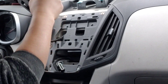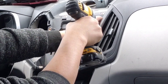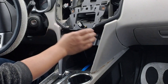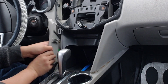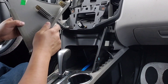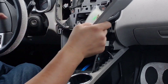This trim, we take it out, but it was a little bit hard to take out. Just slide out — there are three clips and this one, be careful, it's really hard to take out. There are three clips, just slide out. You have to lift it up, like pulling it out from the bottom.